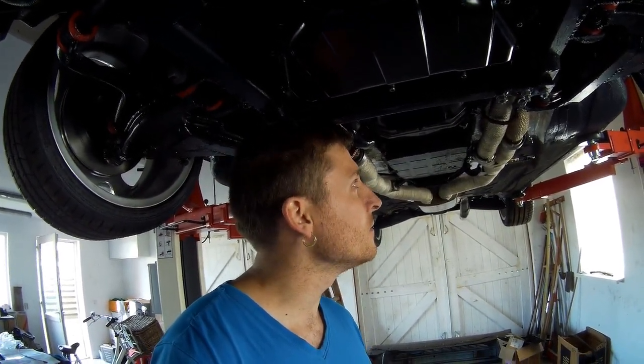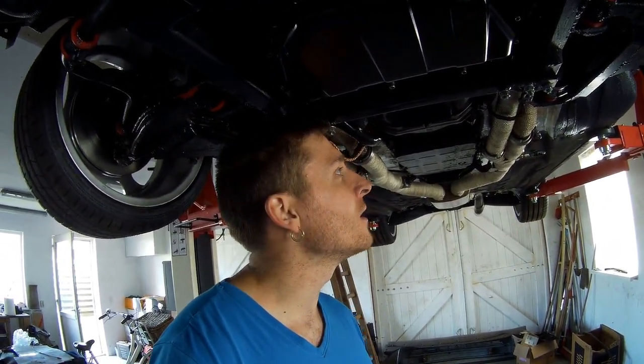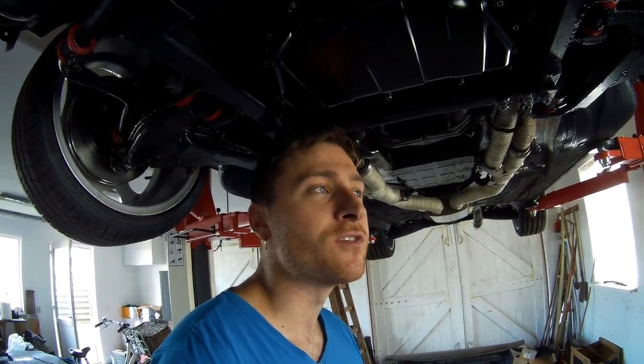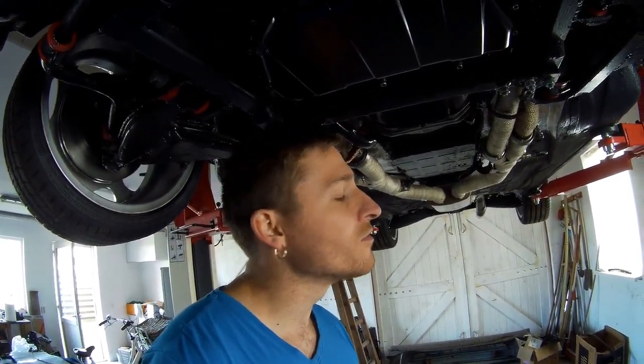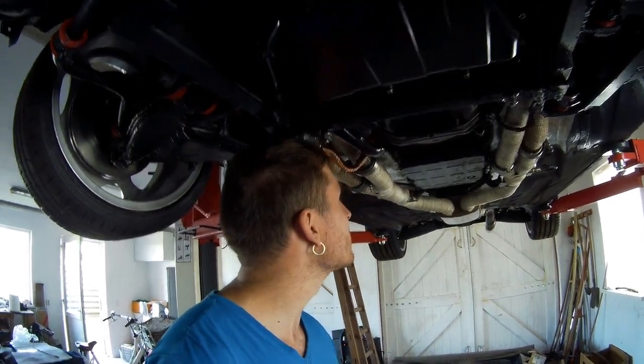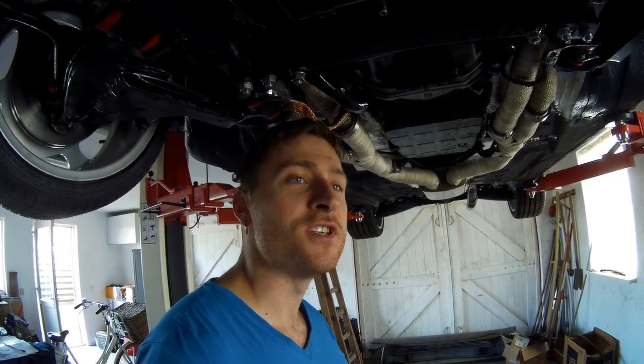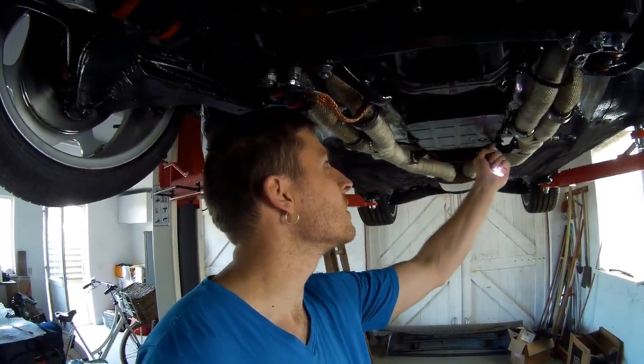So when I'm looking in the manual, it says my system should have around 8.6 liters of oil in it. I have 1.5 liters of oil already in my torque converter, and I've got 5 liters in the sump, so it's 6.5 liters. I think it will be at the limit, and not too low to have it just running. So I think I have to fill it up then, because 1 centimeter of sump level is 840 cc's. That's about the capacity of here.